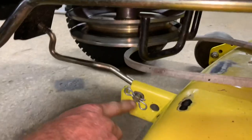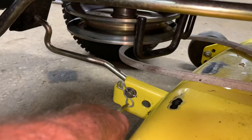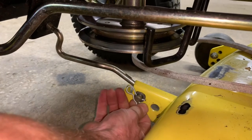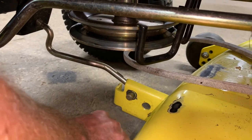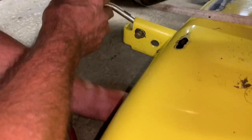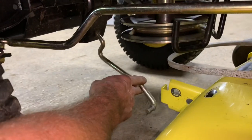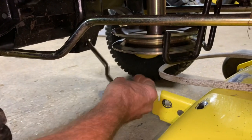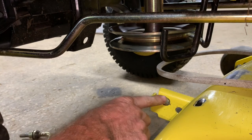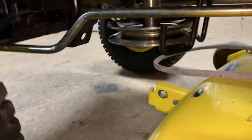Since we're in the front here, we might as well take off this — I call this a butterfly or bow tie clip. These are really nice clips. They're a little tricky sometimes to get off, but if you pull in on the rod here and pull it towards you, it actually gives you some room to work. They're not pinched and you should be able to do this by hand. This one has a washer here that you want to make sure you don't lose. Hold up on the mower deck a little bit so this will come out easily because there's tension on it — watch your fingers when you put it down. Take this out from the front of the hole where the bracket is, so you won't have any chance of bending this rod.